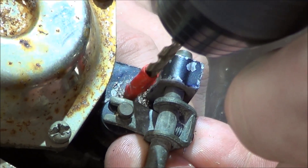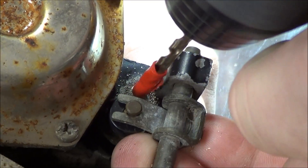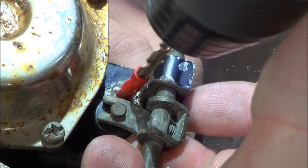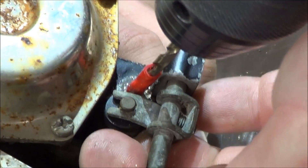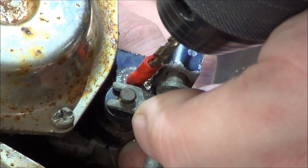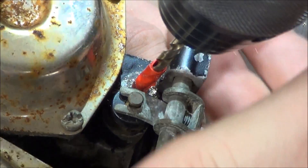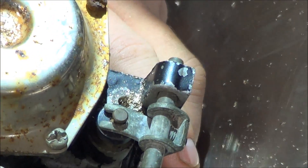If the plug sticks to the drill bit, that's great. If not, we go to the wood screw technique. Something just cracked — that's the Welch plug. It did not come with the drill bit, so we'll do it the harder way. Go ahead and blow that out.